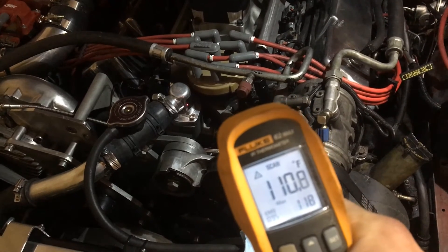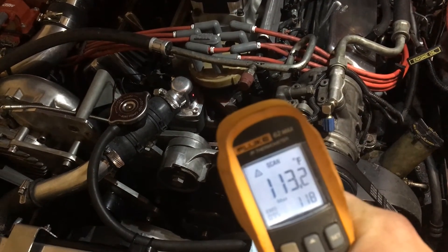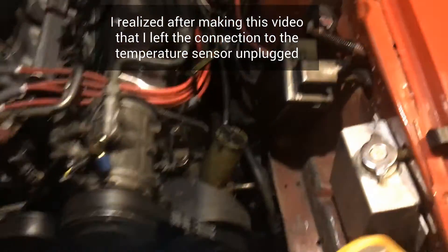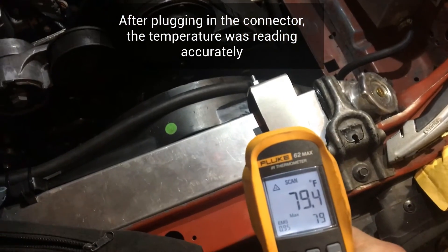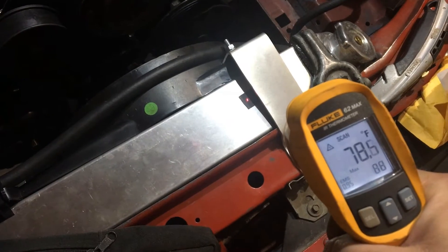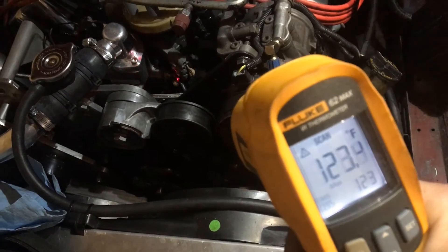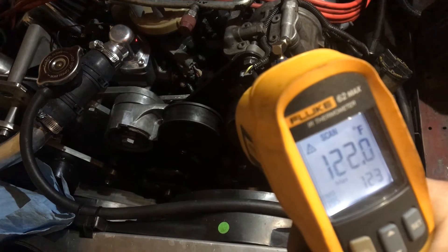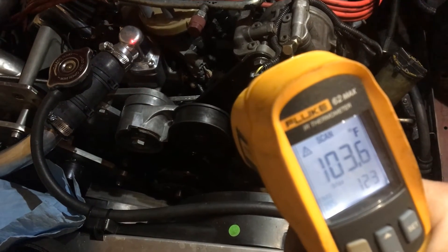I'm seeing 112 degrees here - that's a far cry from 68, isn't it? The lower hose is about 100 degrees. I'm shooting the IR thermometer at a black piece of tape that's on there and getting about 78 degrees. So shooting at a black piece of tape, you can notice that the temperature reading is a little bit different. If you shine it on bare metal you'll catch different temperatures because of the reflection of the light. If you put a piece of black tape on there you get a very steady reading - see the difference? It's jumping all over when reflecting off the bare surface.